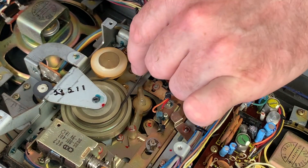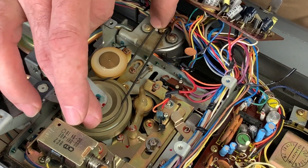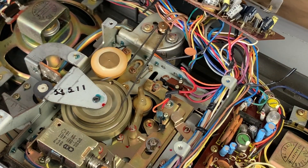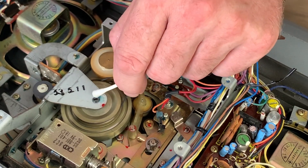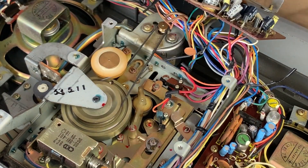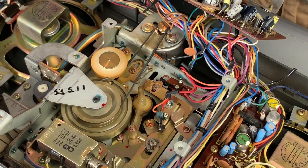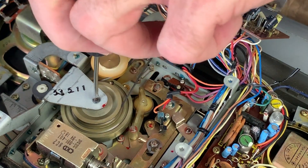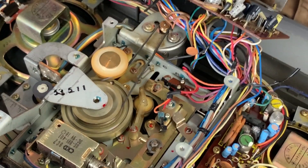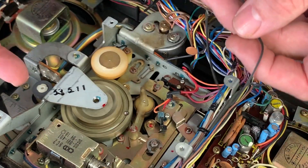Now is a good time to make a note of the belt path. This one is still intact and it's fairly obvious to see where it goes, but you can see the pulleys and idlers are slipping - there's some bite in there but it's on its way out, with a bit too much slack and dryness in the belt. We can actually cheat a bit - I'm going to put a drop of acetone onto the thrust screw here just to soften the lacquer holding it in place, because you can generally slip the belt underneath without having to take the keeper mechanism away. Now the acetone's had a little time to soak, you can loosen or remove the grub screw to slip the belt completely out.